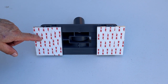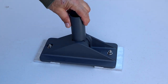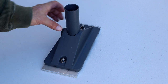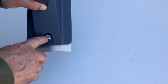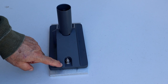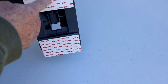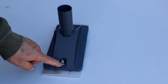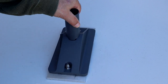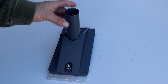I've applied the VHB tape to the bottom of each of the aluminum plates and fastened the aluminum plates in position using quarter-twenty screws with a washer and lock washer. I also drilled a little chamfer in the top of each screw so I could fit a screwdriver blade in there in case I ever have trouble getting it off, since there's nothing to hold the bolt firmly if it gets a little too tight. Now we're ready to go on the roof.